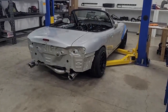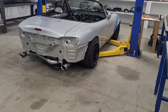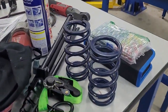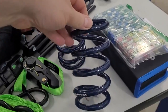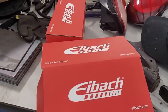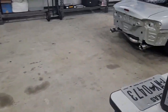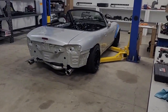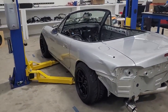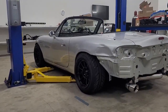Hey guys, welcome back. We're going to do this little video at the end of the day. We've been working on the car and got a couple things done. First, we got our Zeta coilovers - they came with these Hyperco springs that were six inches long, 500 pound per inch. We actually needed shorter ones because we pulled a bunch of weight out of the car and the back was sitting too high. The adjusters were also going to run into the axles, so we bought shorter springs and got those put on today.